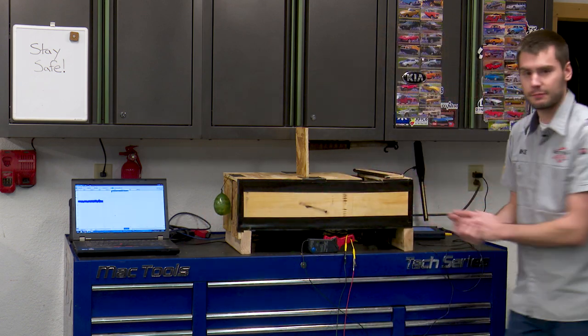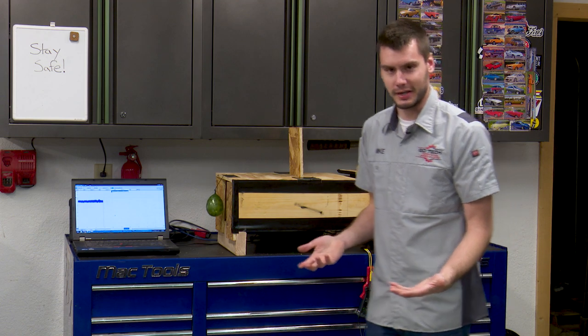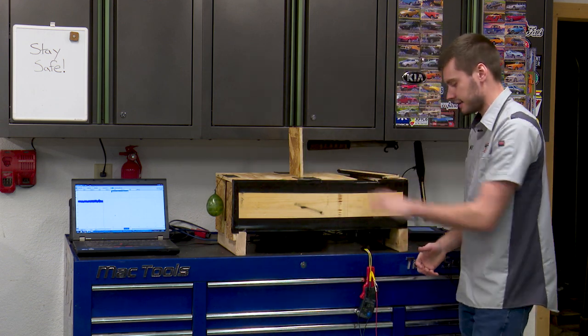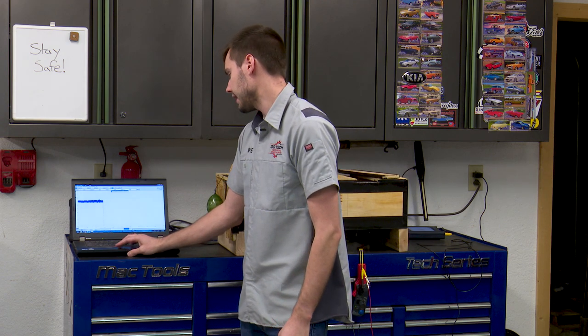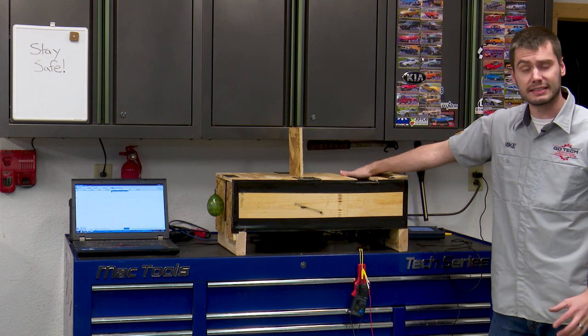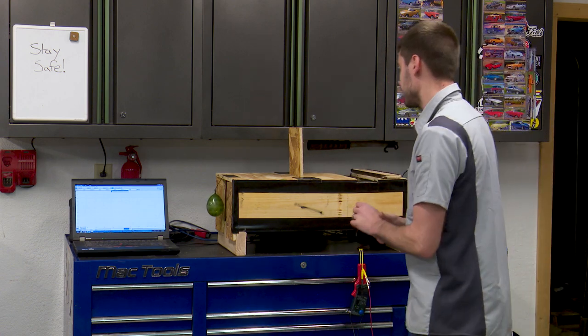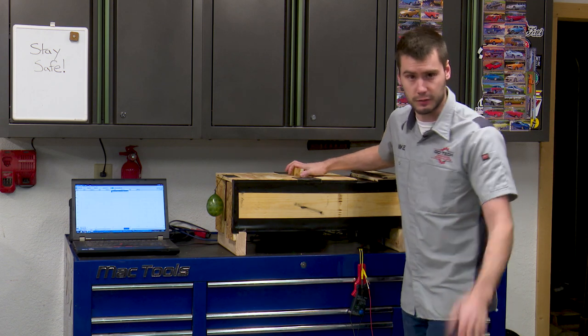It's this monstrosity here that I built — I call her the HVAC 10,000. I don't have the best carpentry skills; it's put together with some plywood and nails, but it's meant to replicate an HVAC case. It's got a blower motor from my Volkswagen that I yanked out today. I have an amp clamp hooked up and the scope running, with the blower motor wired up to power and ground — feeding it a full 12 volts. We have a restriction on the inlet side — like our cabin filter being plugged up — and we're also going to test a restriction on the outlet side after the blower motor, to block airflow leaving the blower motor going to the rest of the ventilation system.